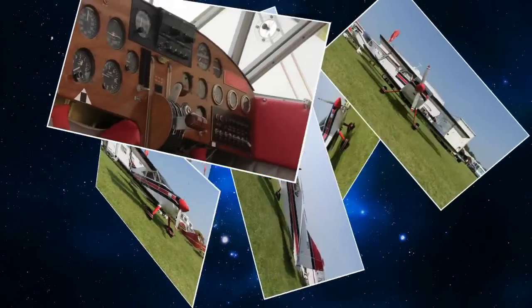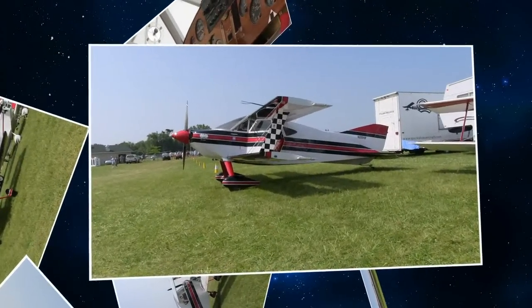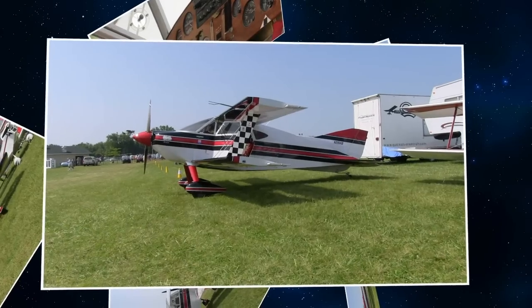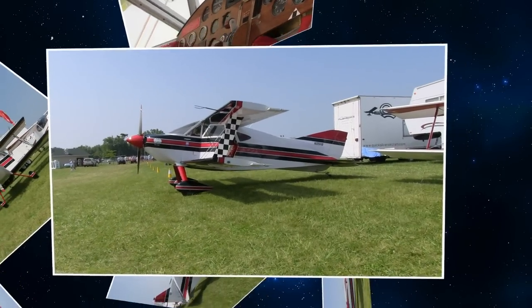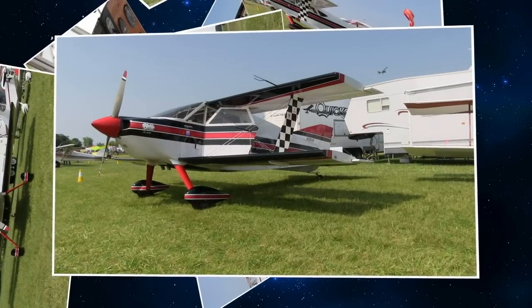Is this equipped with four ailerons or just two? Yes, sir, it's got four ailerons. They're all interconnected inside the fuselage, so that's why you don't see any slave struts. These ailerons are custom designed by Mark Sorrell for more roll rate, and they work really well. The rudder was my design to get more rudder authority for hammerheads, stall entries, and crosswind work.